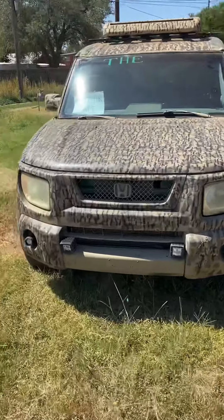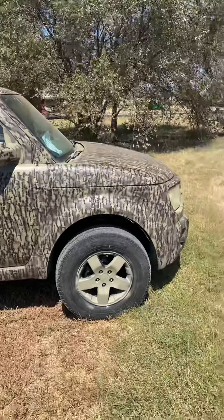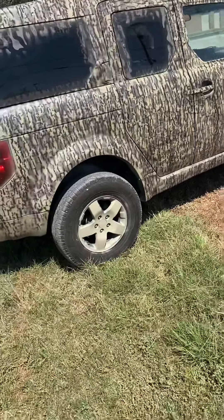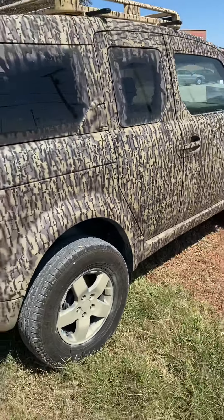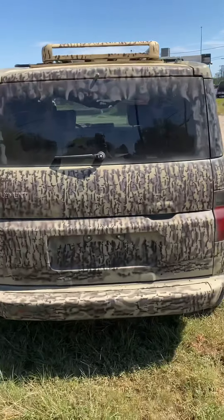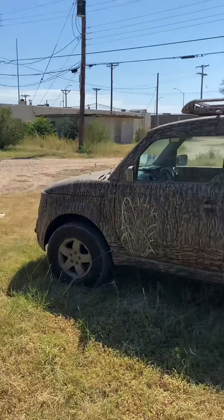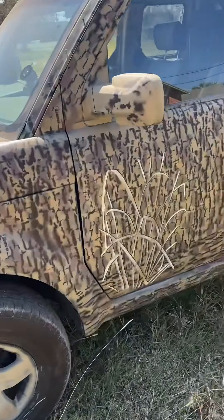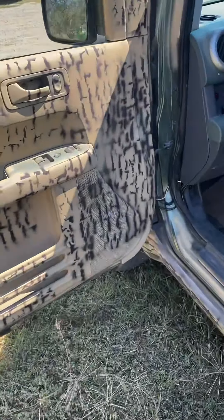Here it is. Notice that it's not crazy loud anymore — I went ahead and put a new catalytic converter on it. I went ahead and put all new glass in it, put a roof rack on it, got new wheels, put tires on there — they're 245/70-16s. I did put one-inch wheel spacers on it. I did a rattle can deal on this, obviously. I'll take it out into a field and show you how well the camo works. I painted the door panels camo because somebody had painted the door speaker neon green or something.